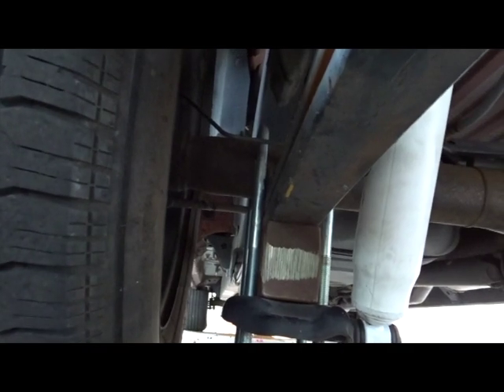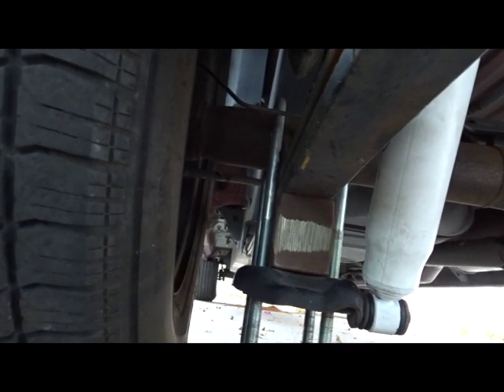The back was not bad at all — the front was the problem. I made a mistake where I put the block on top of the leaf spring, which is not how it's supposed to be. The spacer in the front was a real pain, which is why I didn't record the whole thing. If you guys have any questions let me know. It only lifted three inches in the back and one and a half inches in the front, so it won't be really noticeable until I put the body lift on. Anyway guys, ride safe and I'll see you on the next one.